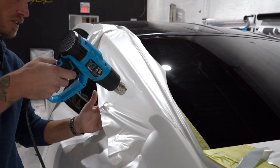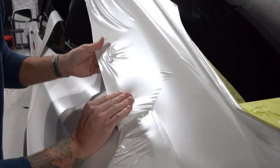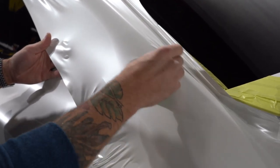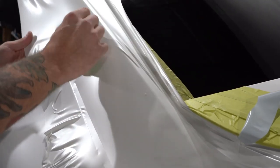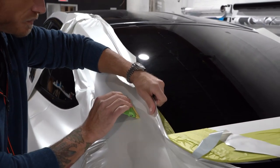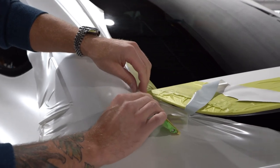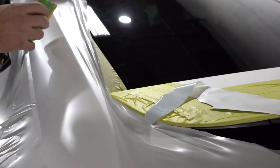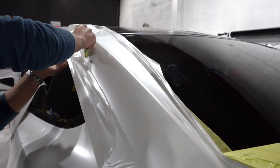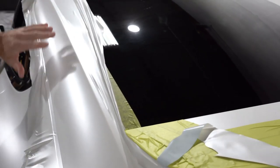Let's heat it and see what happens, then flatten it out. Should be able to squeeze over that — let's use my finger. That was a pretty high profile area but I just got it. Let's go right through — we're smooth all the rest of the way. Let's finish this one off and around this side. I'm going to alleviate all that tension on the edge; I don't want to let it sit there for very long or we'll get a glue line. We're all the way to the edges everywhere — let's move to the other side.